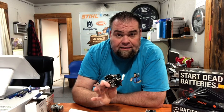If you do not have access to the diagnostic tool and the diagnostic software to update the firmware on these units, you will not be able to get these running in your equipment — you will have to take them to a Husqvarna dealer that has that equipment. I know that is a complete pain, and it is done intentionally to make sure that you have to bring it to a dealer. So if you buy one of these carburetors on eBay, Amazon, or wherever they're sold, just know going into it you are not gonna drop this in your machine and have it work right off the bat. Stihl Mtronic carburetors, on the other hand, all you have to do is disconnect the wire from your old carburetor, plug the new wire into it, drop it into place, and you're good to go — there's nothing to update, no computer software to run.